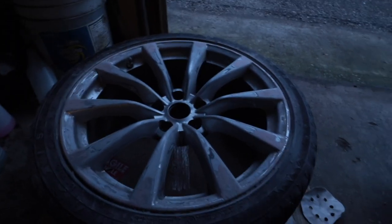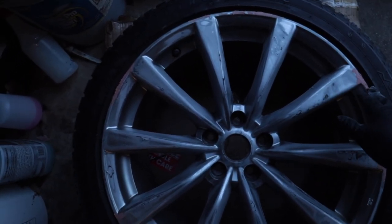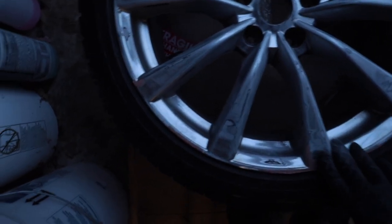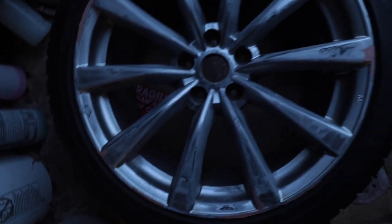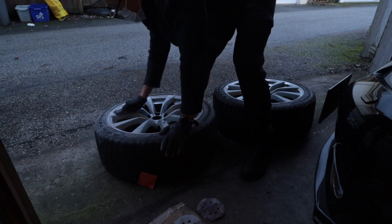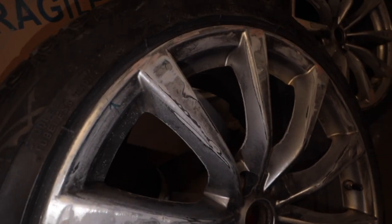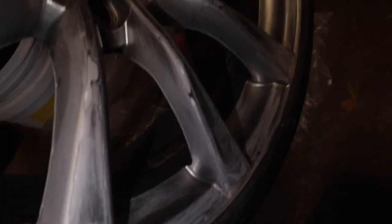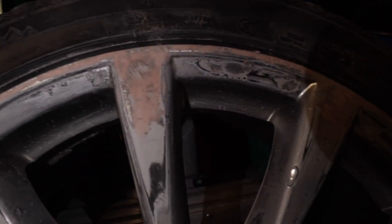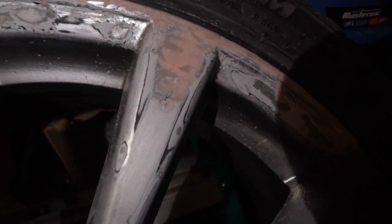The edge of the wheel is pretty smooth. The other three wheels aren't as bad as this one — this one was probably the worst. The other three are mostly just curb rashes on the edges, not really any major gouges on the spokes. I sanded down most of the wheels but I'm pretty sure I missed some spots, so I'll alcohol wipe them down and put some more bondo on the parts I missed, like some deeper divots that need smoothing out.